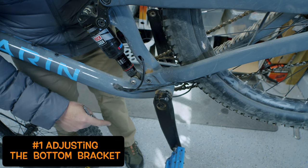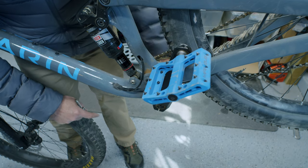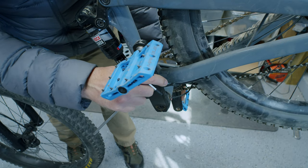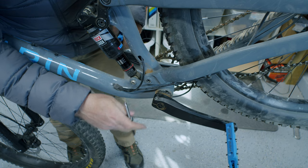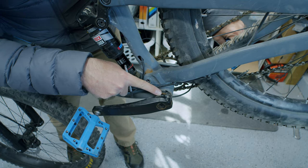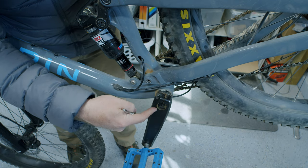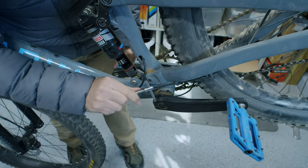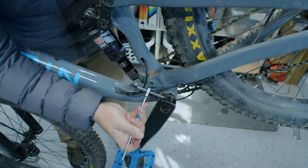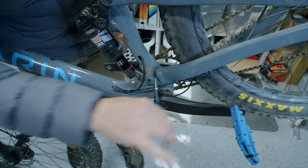One of the first things I noticed was that my crank arm and bearings were feeling way too tight. Normally if the wheel was off here you'd feel little to no resistance, but I could feel quite a bit of tension. Checking the crank arm back and forth I could tell something was over-tightened. There are two sets of pinch bolts that are supposed to be torqued to a specific ratio, and my suspicion was that when the bike was assembled they had over-tightened the retaining bolt.